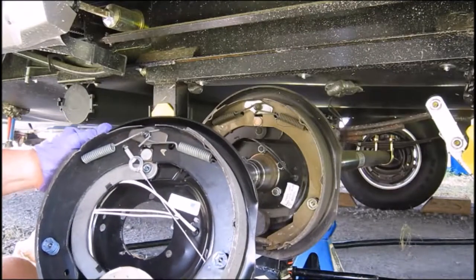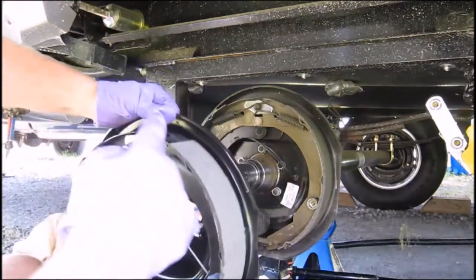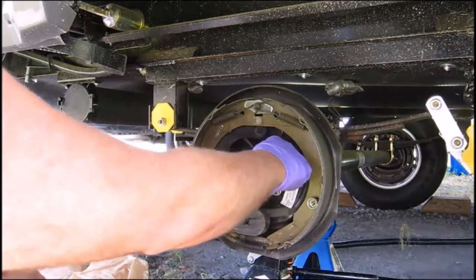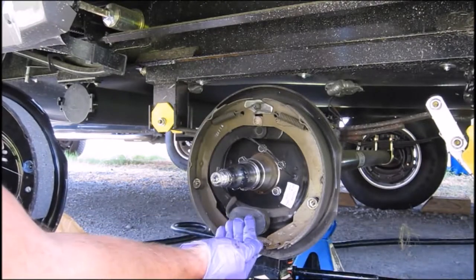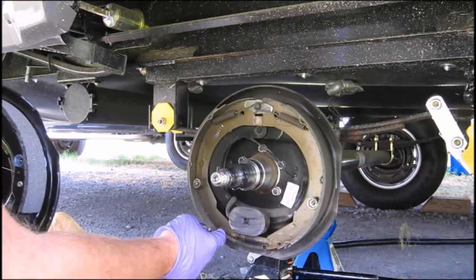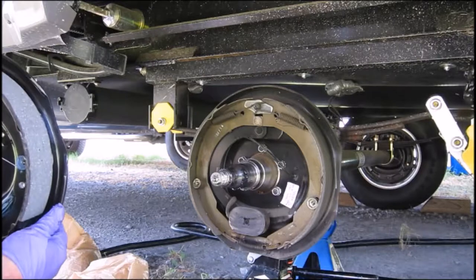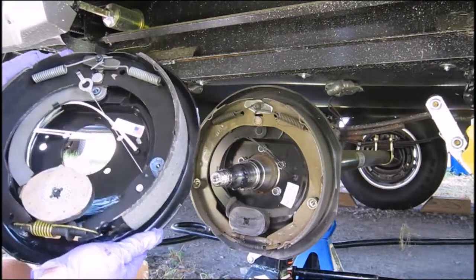You don't want to touch any part of the pad with greasy hands, or the brake magnet — keep from doing that. When you change these out there's a wire that goes to the electric brakes. The electric brakes energize and come around to energize the magnet, which causes it to slap up against the inside of the drum. That friction makes it push the pads out — the magnet grabs the drum and the turning is what causes the shoe to engage. That's my understanding of the concept.